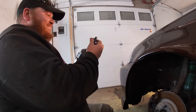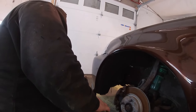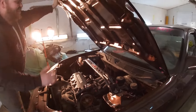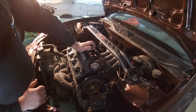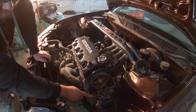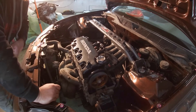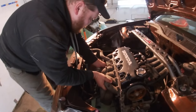Bingo. So I guess we're doing a head gasket. I don't know what we're going to do with this hood — maybe I should order the proper stuff so this hood will hold itself up. He's going to do this one motor mount. Once you undo the motor mount, pull it out, pull the crank pulley off, then take the cover off, water pump and everything else. The valve cover is just sitting there so that can pop off. The turbo is just a couple of studs.